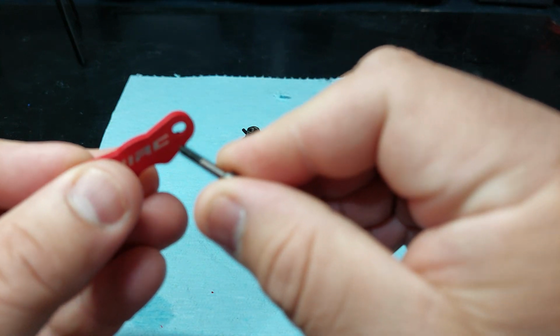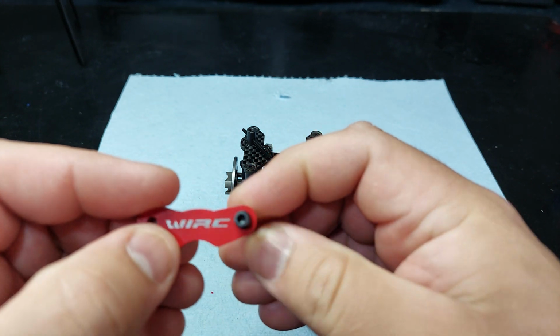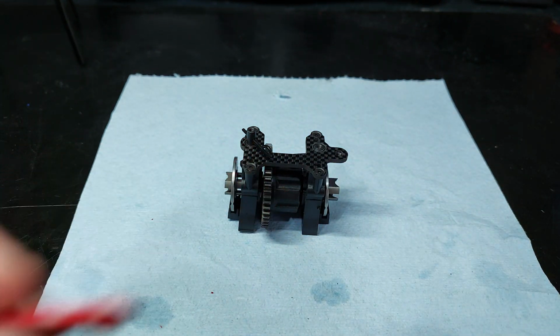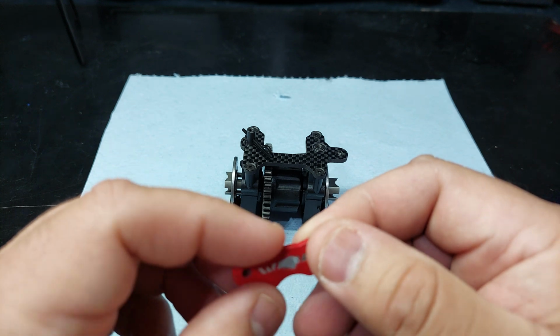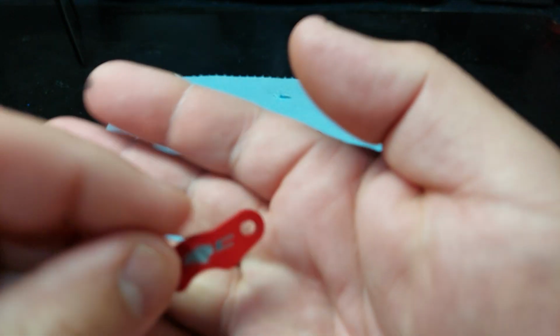That's the whole point. Here's the elongated side again, no issue, and that one has a little bit more play anyway, which is by design, I'm sure. But this side is the one that was hanging up, so that's the one that I ream. Another thing that I did, I mentioned yesterday that when it came to the brake cams, this is where the brake cams contact the caliper.